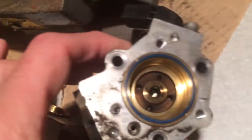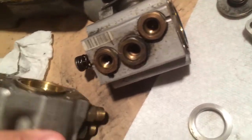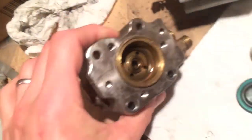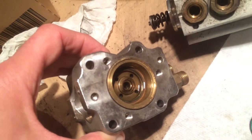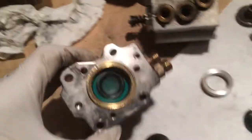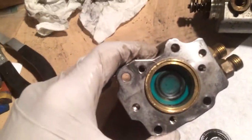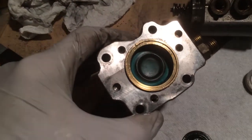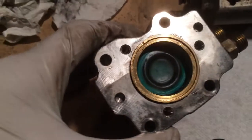It should look like this — just perfectly clean brass coming out of a healthy pump. This one is coming out of a pump with 135,000 miles. It could also be that gasoline just interacts differently with this stuff than diesel does — diesel is a great lubricant, gasoline is okay but diesel is different. So: an Audi pump with a healthy diaphragm versus my pump at 135,000 miles. Would I use this Audi diaphragm? Yes, I would — I'd probably buy a new one though. But it fits perfectly, it's obviously the same exact part, and even these metal rings are the same part.